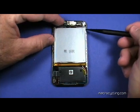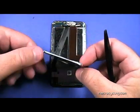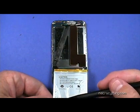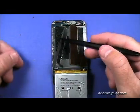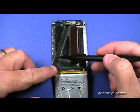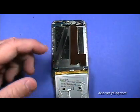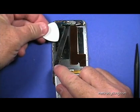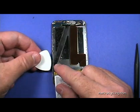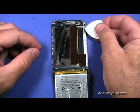This is a shot of the first iPod showing the position of the ribbon cables under the battery. Note the position of the glue points. Notice that the closer you get to the bottom of the iPod, the closer the ribbon cable gets to the edge. If you run the plastic pick all the way down the left side, you will almost certainly damage the ribbon cable. The right side is a bit safer, but again, take care as you approach the bottom.